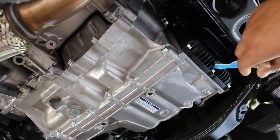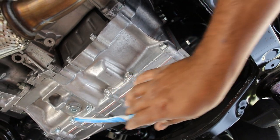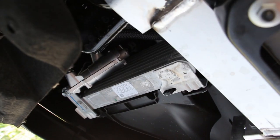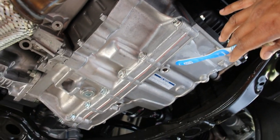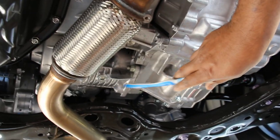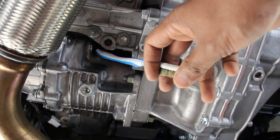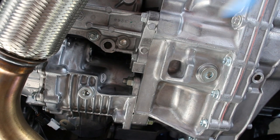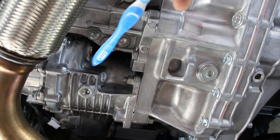Taking a look at the transmission from underneath, you can again see the valve body cover and the drain port located over here. Following those transmission lines, it comes to the transmission cooler — a small separate unit off to the side, separate from the radiator. Once the 8-speed automatic transmission decides what gear it's going to be in, it's going to send the power out to the front differential and then over to this transfer case. That transfer case has got a fill port up here and a drain port located down there because its fluid is separate from the transmission fluid — and you will have to service that after a while.